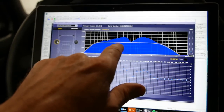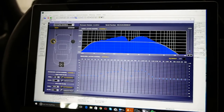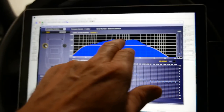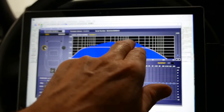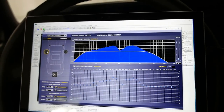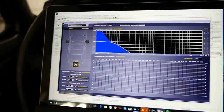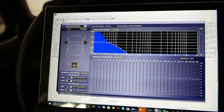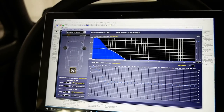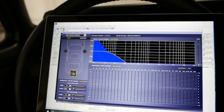There's a hollow spot there, and then a resonant peak at 500 hertz from acoustic coupling. I also have to fill in the upper mid-range, probably because the grill and mounting are muffling the mid-frequencies before the crossover comes into effect. For the subwoofer, it's not critical to equalize it heavily, but I've boosted the 20 to 40 hertz range — the seldom-used deep bass range. I cross over the sub at 70 hertz, not 100-plus, because that starts getting mid-bassy and muddy. The door speakers are flat down to about 50 hertz anyway, so I'm just filling in below 50 hertz for very deep bass punch.